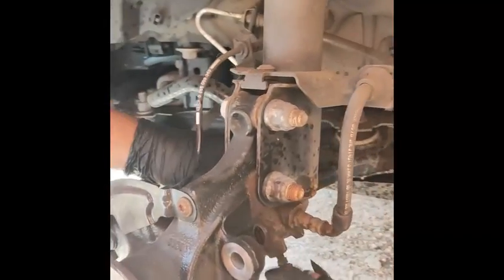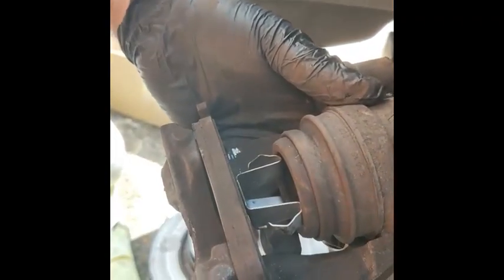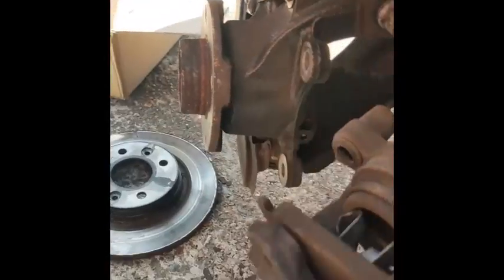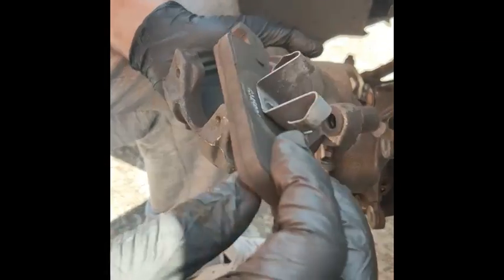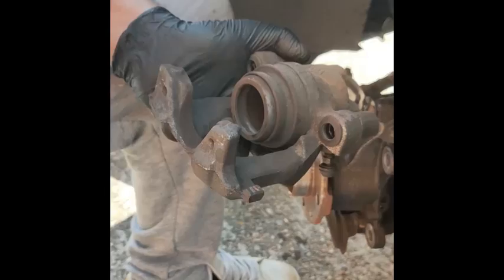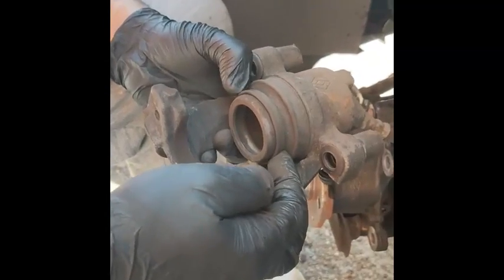I want to just show you the piston. So this is the piston, so we're going to wind this back, but the other brake disc is there, as you can see. If we push it out, it's literally like a little clip that's going in there. So we'll get that out slowly, and then push this back a bit, so we can put everything back. So yeah, let's put that back there. So this is the back brake pad. As you can see, it's got clips on it, so it goes in there. All you do is pull the clips out, twist it up, and then it'll pop open. So we're going to push this back as far as it can go without damaging the grip there, because that covers the piston. So in here is the liquid itself.